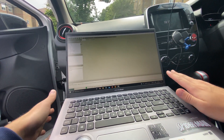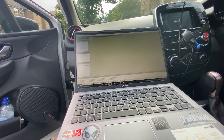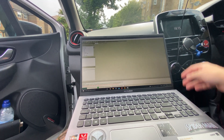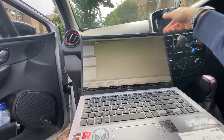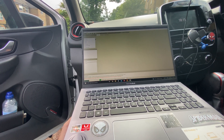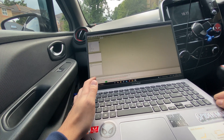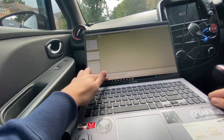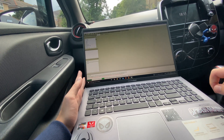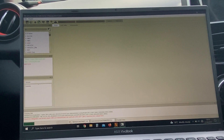While it's reading or loading, if your speakers make strange noises that's normal — because what we've done is modified the splitter cable so it can connect to the R-Link one unit, and sometimes the speakers make strange noises because of it. Also while it's reading, if you do get red writing on DDT4All that's also normal — don't worry about that.